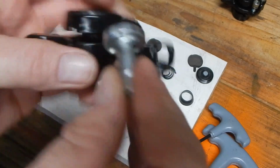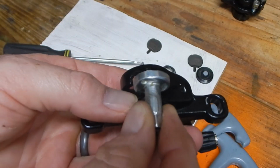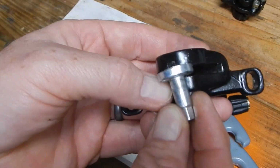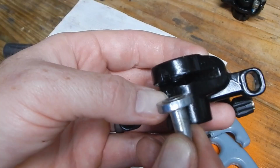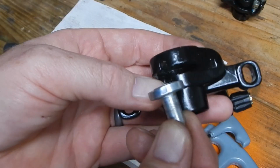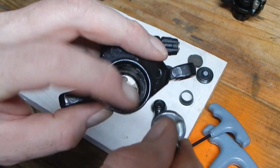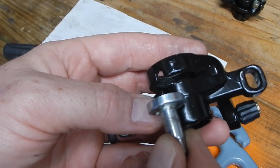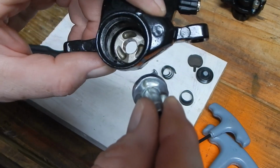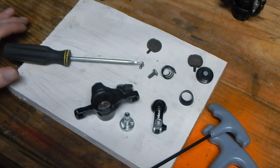And that ball bearing, with the 3 of them, they get to where they actually push this through its rotation out. I should be rotating this way. And as those ball bearings drive up the ramp, this pushes out this way. So it retracts in. I'm exaggerating it for effect, but it retracts in when they sink down into the deepest point of the ramps. And then they actually force this out as they drive to the shallow point of the ramps. Very neat. Very, very neat design for me. I love seeing how things work.